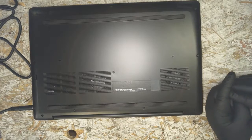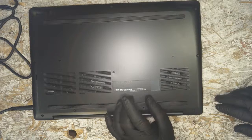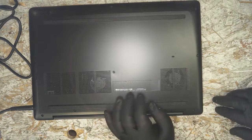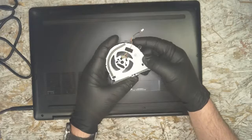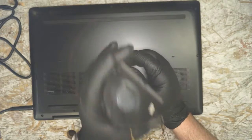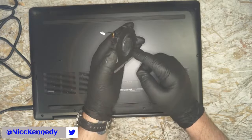Some people have said they've solved it by putting spacers in different places, and how you could tell, you'd have to make a special adapter. You're going to have to find a jack or find wires with pins to plug in to your fan. But you actually make something. Plug this into 5 volts, get your positive and negative right, spin your fan up and listen to it. If you have to, press it to your cheek, your forehead, and you will hear the buzzing in the fan even at a low or high RPM.